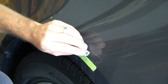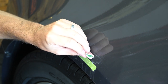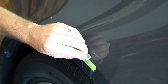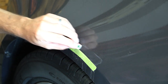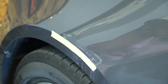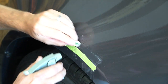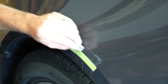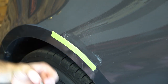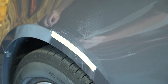Like I said, a lot of times you see guys when they start pushing, what'll end up happening is even though you got a block, you start digging some uneven scratches. It just makes it a little bit more difficult after the fact when you're actually buffing to smooth those out. So I just like to use light pressure, and maybe about every 10 or 15 passes, add a little bit more water. And when I'm done with this 1500, I'm going to come back over with 3000 just to smooth that up. I'm going to move back onto this one.